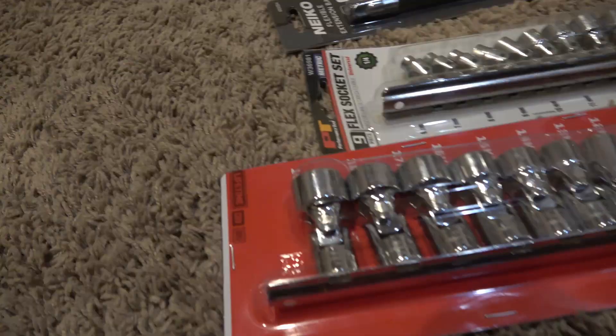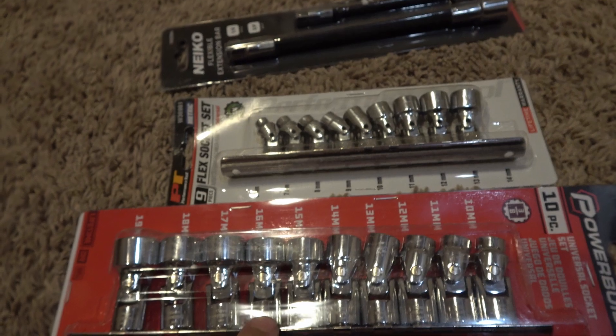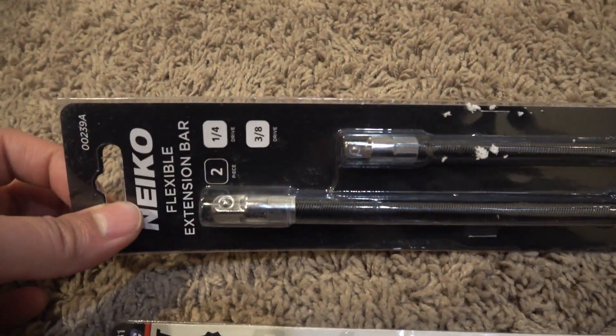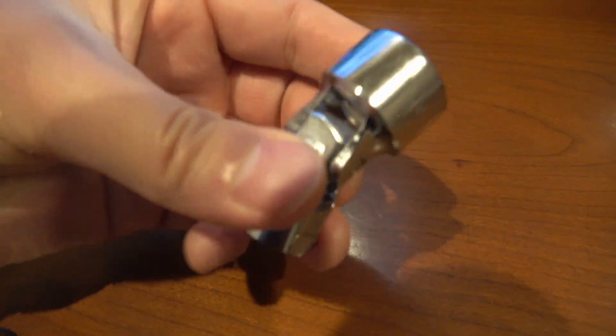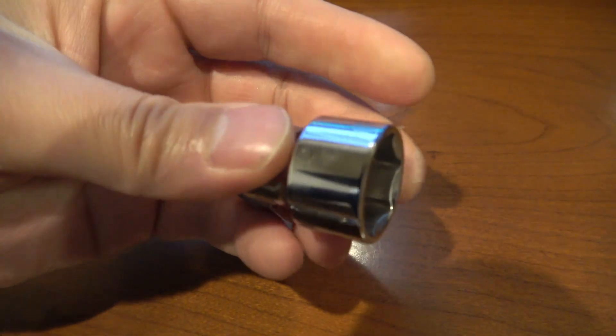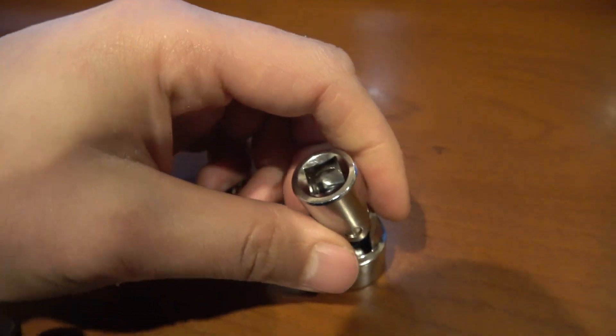These things are heavy. I went ahead and ordered a brand new set of wobble sockets in metric, both in three-eighths and quarter-inch. That way when I do the reassembly, these would have made the de-installation process so much easier. I also got some flex extensions for bending around corners in three-eighths and quarter-inch. I'll have a link in the description of all the tools I used on this turbo de-installation. With a swivel socket, wobble socket, and normal extensions, you should be able to get to all angles on those exhaust manifolds - that's what took the most time and was the biggest pain.